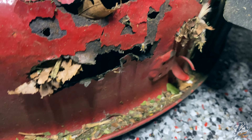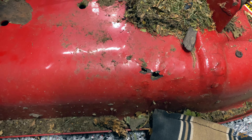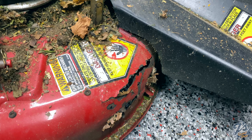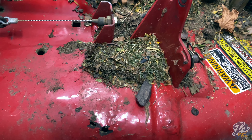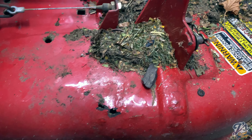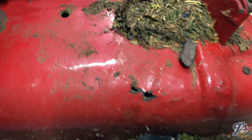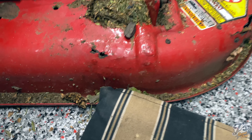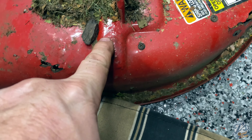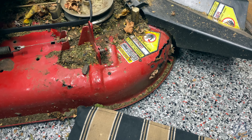Here you can see our worst damaged area we're going to have to deal with, and there's a little bit more right here. The curves are going to be a little bit tougher - unless I do it in two pieces and kind of box it out. I'm still debating. Again, if I have to weld it, I'm not really a welder, definitely not on this thin of metal. This piece I could just fold over from down at the rail up and tack in place. Although it's pretty crusty up in this ridge. When I get this apart and see what's there, maybe this thing's not even savable at this point.